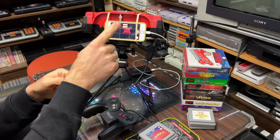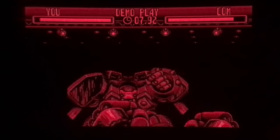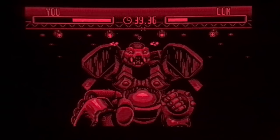The way this display works is it has one vertical row of LED pixels. Then it has mechanical mirrors which oscillate really fast to spread them across your field of view. If you put your ear up against the Virtual Boy when nothing's playing, you can hear a very faint hum from the mirrors moving so fast.